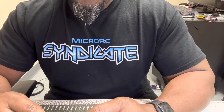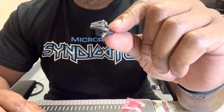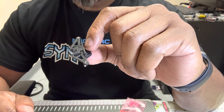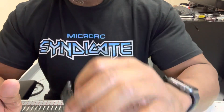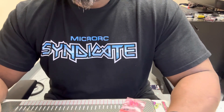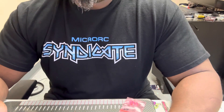Another feature I've been kind of quiet about: anyone who's run 1/12 scale knows what dynamic caster is. The upper arms, instead of being flat, I've angled them back. What that does is the more suspension throw you get, the more caster you get at the same time. To put it simply — if you have two degrees of static caster and the car goes into a turn and plants mid-corner, you'll probably get another degree of caster, which gives you more steering on exit. So it's easy to get good entry steering along with mid and exit steering because of the dynamic caster.